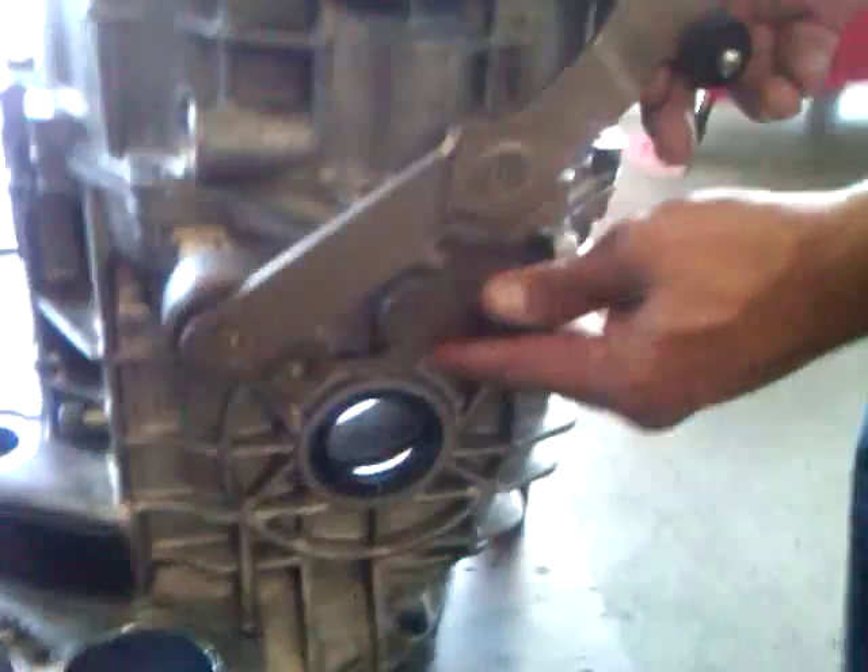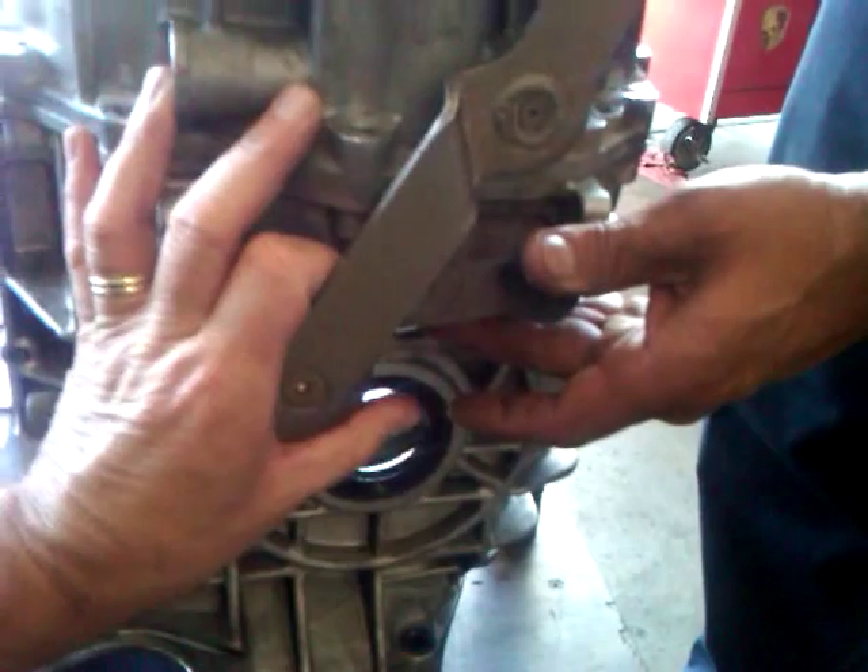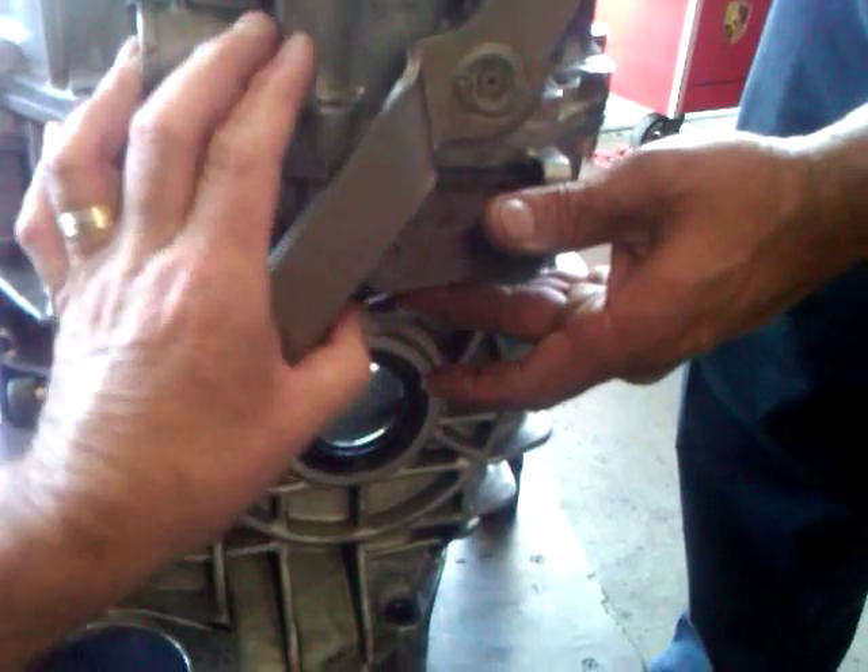But if you look through the actual fill hole — Ray, if you want to move the gear — there we go. We can see that it's definitely going all the way into gear. And to show you what we found, it's modified already, but if you push down towards the bell housing with the little lever and you go down into gear, it will actually move the little lever a little bit.